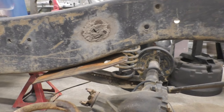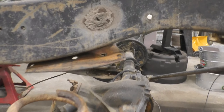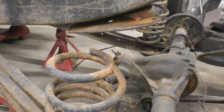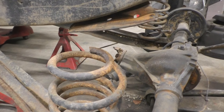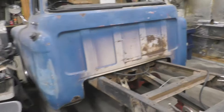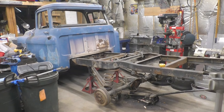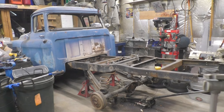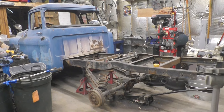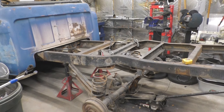We'll bring it out straight with the frame and build the spring mount on that. I might have to slide that cross member a bit to get the spring sitting on it properly — right now the hole might be a little far back. I'm going to get the springs out so I can lift the axle up to where it'll actually be at ride height. The truck is sitting really high on the jack stands with quite a rake to it, and if I jack the axle up to where the springs are hitting the frame, it's actually raked even more than this, which is too much.